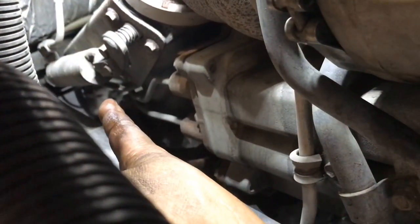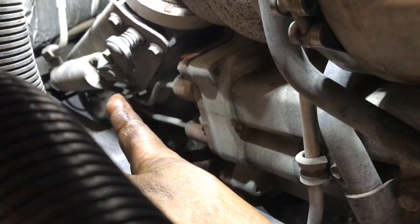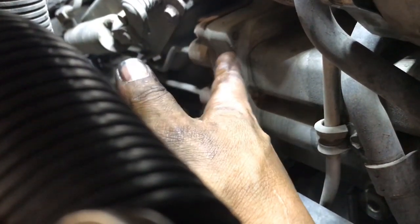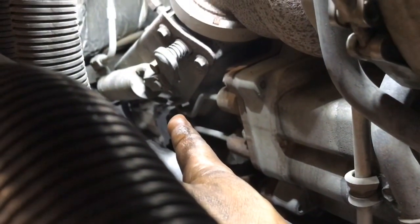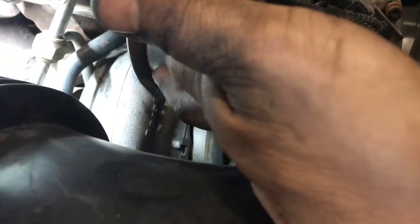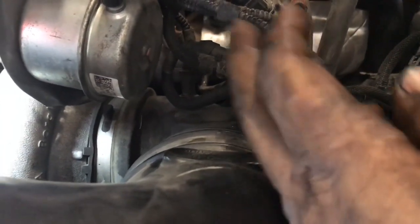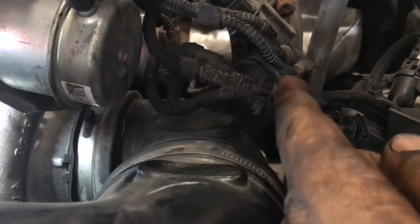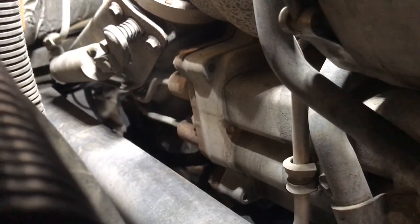Matthew, make sure that little exhaust brake cylinder is not stuck fully open or stuck at all — it has to function for you to be able to spool up on the turbos. This vacuum diaphragm also has to move freely. Check that the diaphragm is okay; maybe the servo is getting the signal and opening the vacuum, but the diaphragm could be busted. Check the control valve, the diaphragm, and the exhaust brake.